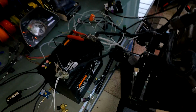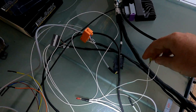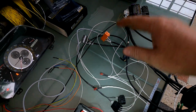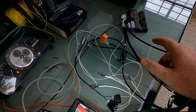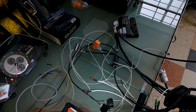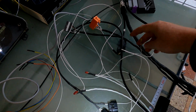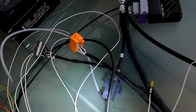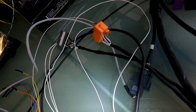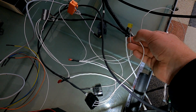Okay. Now I'm controlling the fuel pump via this little fuse over here, but obviously everything is built into your car. As we discussed with Tom, what we'll do is replace the fuel pump ECU with a relay in order to control that, just to bypass that thing, because they break and it's just not worth it at the end of the day. So I'm going to quickly turn on the fuel pump here. Okay, so we got the fuel pump kicking, and obviously your starter is in the fuse box plug over there. And here we go.